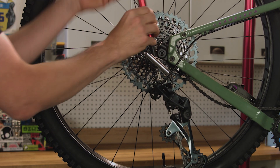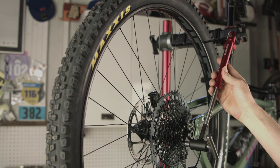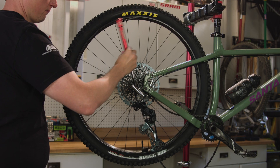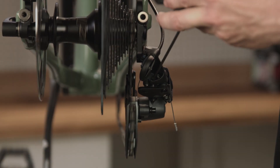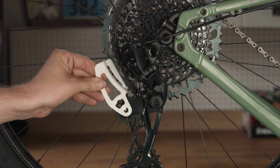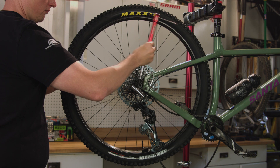The first thing to check is your hanger alignment using a hanger alignment adjustment gauge. This is a specialty tool, so if you don't have one, please visit your local bike shop or favorite mechanic for assistance. Note that you can adjust a slightly twisted or bent hanger, but if you notice fatigue marks in the metal or significant damage, replacement may be the better approach as the hanger could break while straightening or worse, while out on the trail. If the hanger is bent, no amount of limit, cable tension, or chain gap adjustment will restore proper shift function — always check hanger alignment first.